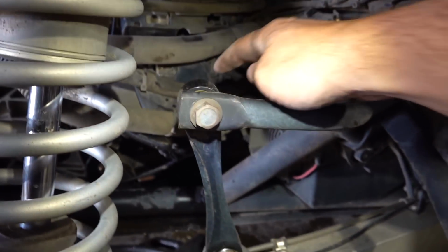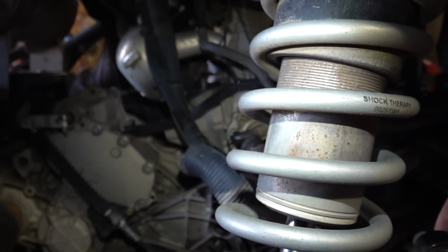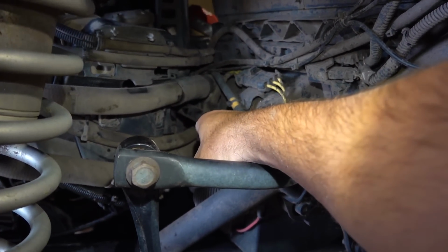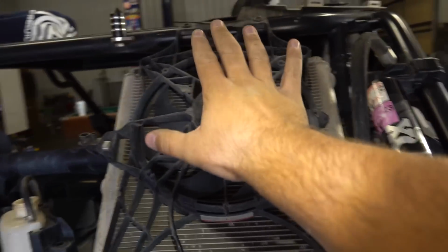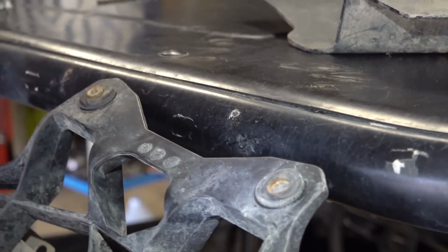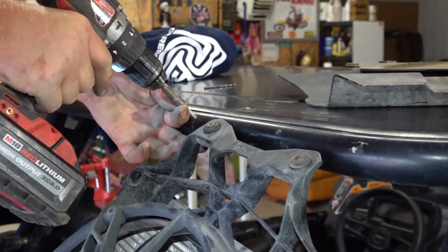Yeah, so this is a little bit crazy down here. We got to looking into this spot right here, off the outlet and the inlet of the actual water pump, there's a junction box. And that junction box also houses the line that comes off the degas bottle. So we want to keep all those things, so we're just going to leave those there. And then from behind the passenger seat, bring the coolant lines up to this radiator. I flipped it around on the fan, so I just moved the fan to the other side. And I trimmed off this. We're good, buddy. Ghetto say what? We got this, dude. Pre-drilled. That's how you know it's a good self-tapper when you pre-drill it.